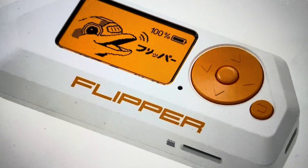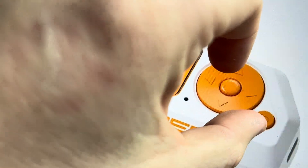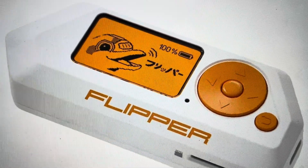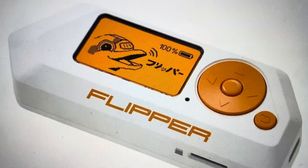All you need to do is press and hold the up button and the back button simultaneously for 30 seconds. You're just going to continue to hold them and count 30 seconds. You should see a countdown appear on the screen and you should not let go until that countdown has completed.